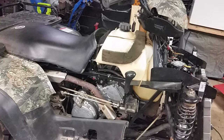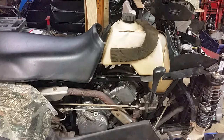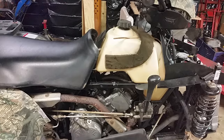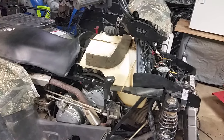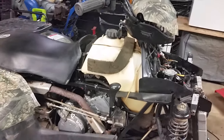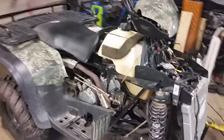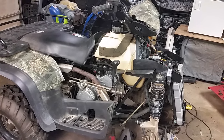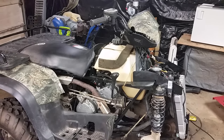Fortunately I've got a bunch of these 500s laying around, so it didn't cost me a whole lot. But if you're having timing issues, double-check your timing, check your cam, check your lifter spacing, make sure that's all good. Most people would say giving it gas and it dying is a carb issue, but this turned out to be all electronic. So if you're scratching your head trying to figure out why your Polaris 500 starts fine but dies when you give it gas, check that CDI box. Hope this helped — thanks for watching and subscribe to my channel.